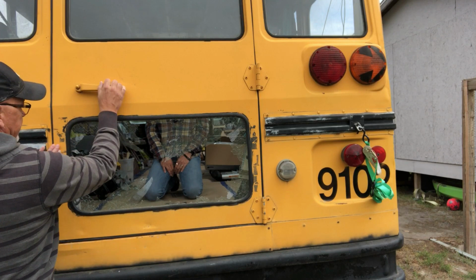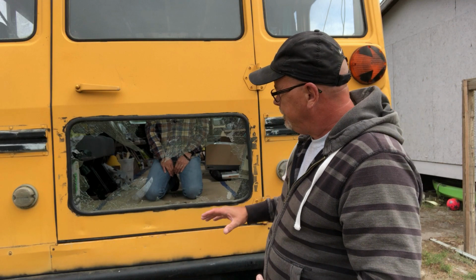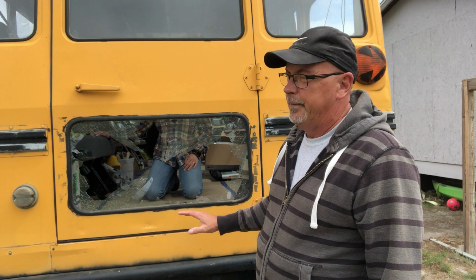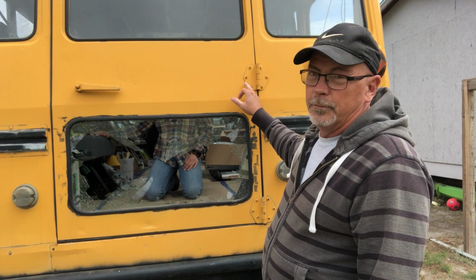because that's going to be the lower part of the garage in there under the bed, and we really don't want to advertise all of our batteries and solar, so we were going to weld a panel over this. We're just moving this up an extra day or two in project. My job today is going to be to get this out, cut a piece of steel, and weld it in here, eventually put body filler around it and prime this, and no more window. So if you're keeping that window, replace the strap I showed you a little bit ago.